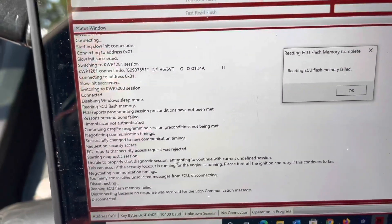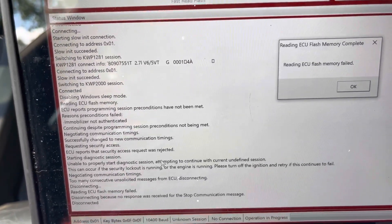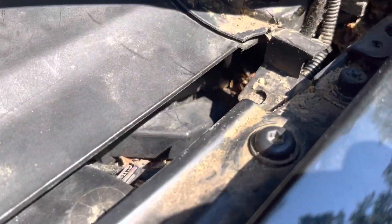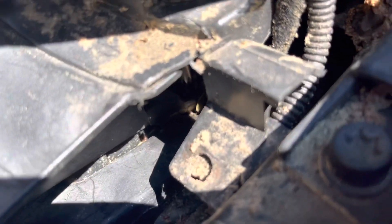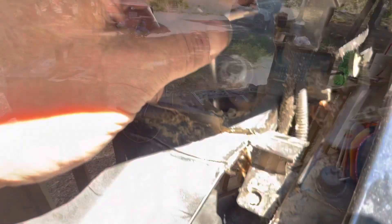What I'm going to have to do is put the ECU in boot mode and force flash the new data onto the drive. I just wanted to point out — I know everybody has a hard time with this bolt. That's how you get it out: take the windshield wiper arm off and stick the torque wrench down through the hole where the wiper arm goes. The head of the bolt is right there, and it's a straight shot as long as you take the windshield wiper arm off.